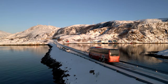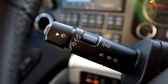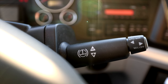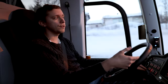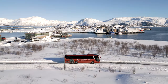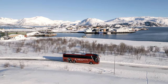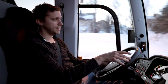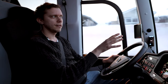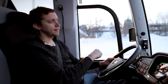To my left of the steering wheel, we have the blinkers and the window wipers. To my right, we have the retarder, and it's not a physical retarder — you have up and down steps. If you want to release the retarder when you're on step number four, just push the button and you are rolling freely again. And if you push it while just driving, it will go all the way down to maximum. Also, the brake pedal has a function — if I push it a little bit, it will keep the speed down the whole hill, so I don't have to worry about over-speeding downhill.